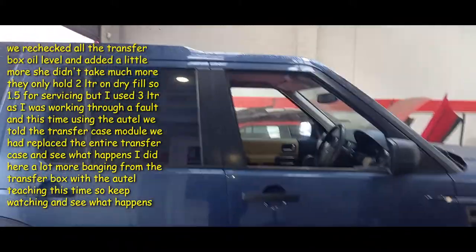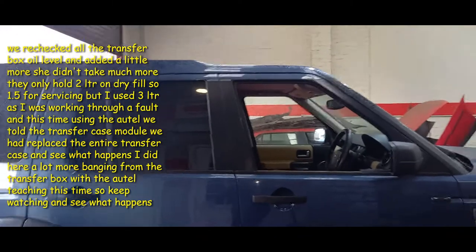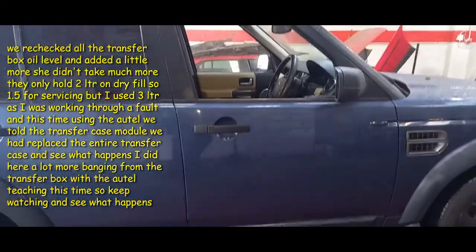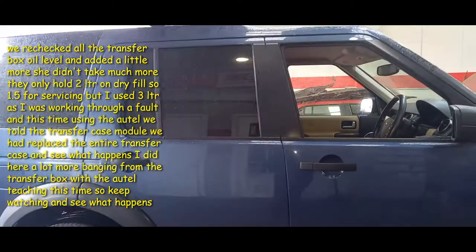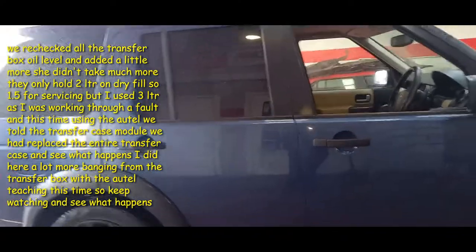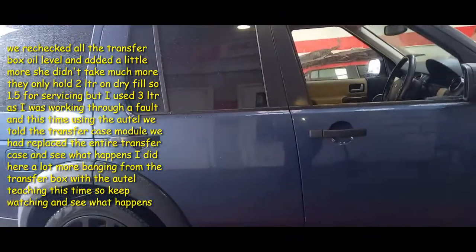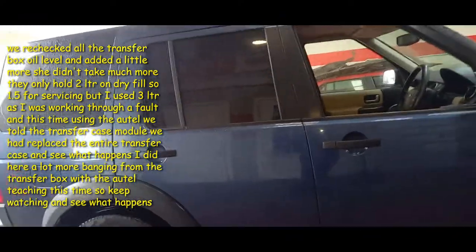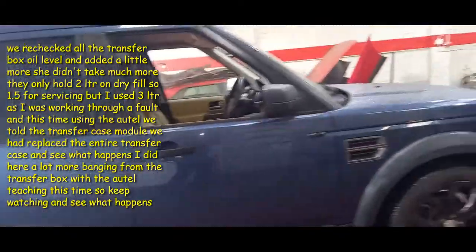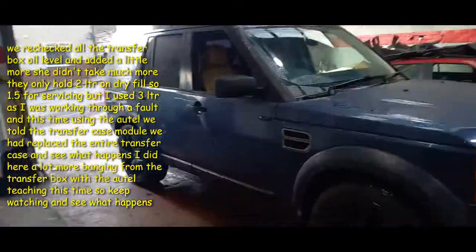And then you can be lucky, like we have been here. Although we have put a motor on it, that was saying the clutch position, the motor was stuck, basically. So we've put another motor on it as well. But I think what's happened is the actual clutch has been locked up, it's been stuck. We've seen the oil that was in it, the oil was absolutely black, burnt to death, and I actually don't believe it's been the right stuff that's been in it. So yeah, really pleased with that. I think my smiley faces have been washed away, but that's all good.